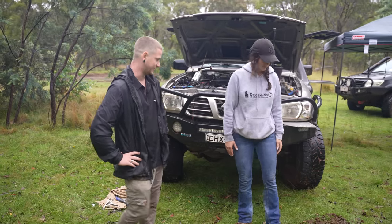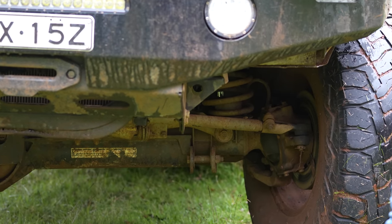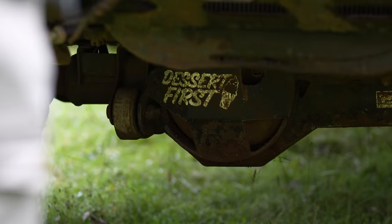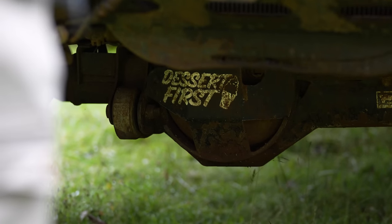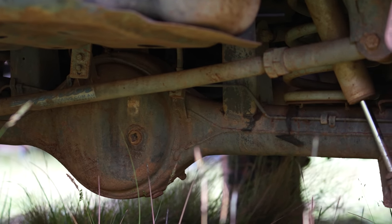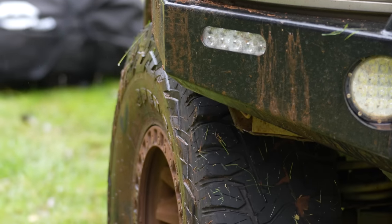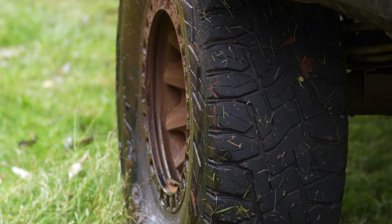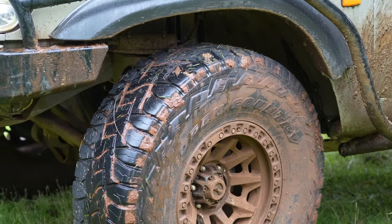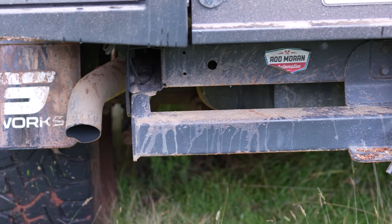Let's dive into suspension. No bash plates — I just let my ride support take the run of it, though I'll look into that. On the front diff I've got a bolt-on brace to help protect it, since the Patrol diffs sit quite low. I'm running 37s and I also have 4.01 diff centres, so it's not an ideal setup for off-roading — I chucked some 63% reduction gears in to fix that problem and slow down low range. And then I've got twin airlockers — front and rear. I drove it unlocked for about three years but then thought it was about time I stepped it up and twin-locked it.